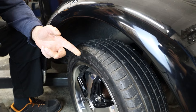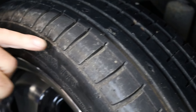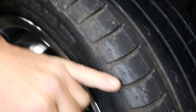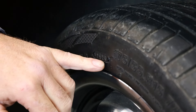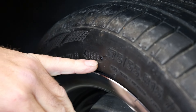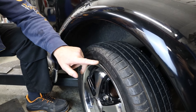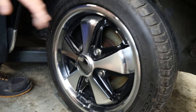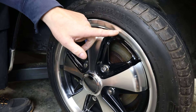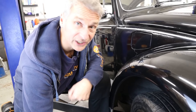Number six — wheels and tires. We need to check the overall condition of the wheels and the overall condition of the tires. With the wheel turned slightly, we can check the tread depth right the way across the whole tire. Also look on the outer wall for cuts and slices. The key thing to double-check is the actual date of manufacture of the tire — this one says 1920, which means it was manufactured in the 19th week of 2020. Also, when checking your alloys, if you find scuffs and curb abrasions, it's another good bargaining point to get money off the sale.